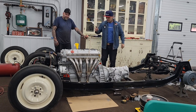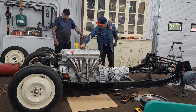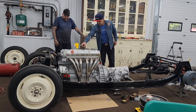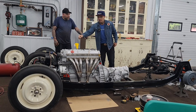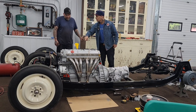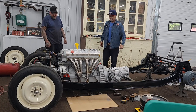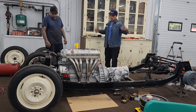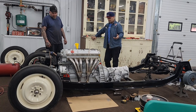He's actually played with the carburetors, got some new line put on that, because as soon as he put gas in, they were leaking. We've got some gas in the funnel right at the present moment. So if the gas stays in the funnel, it's not leaking past the needle and seat, so that seems to be fine. So basically, we're going to turn it over and see if it runs for the very first time on fuel by itself.